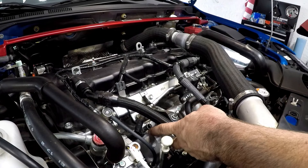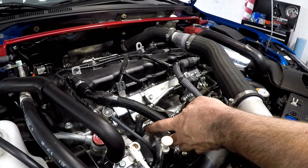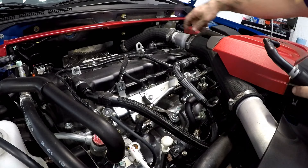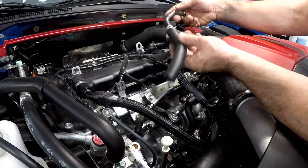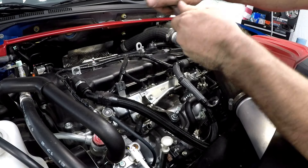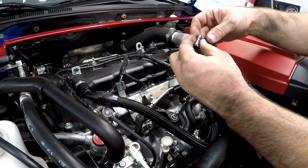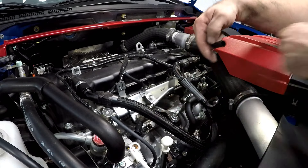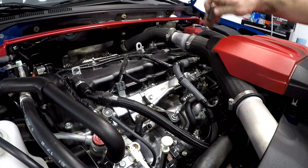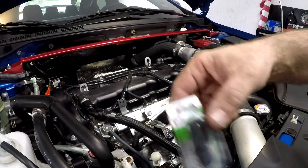STM sent the clamps but not the caps, so we just grabbed some 3/8 inch rubber vacuum caps from AutoZone. This little elbow went onto the back of the intake — this part goes into the intake, and this end used to have the hose that ran over to the back of the valve cover. I'm just going to squeeze the vacuum cap onto this end — it's really tight, so it takes some force, but it definitely won't fall off. I'll put a zip tie or clamp on it as well. That elbow then goes right back into the intake.